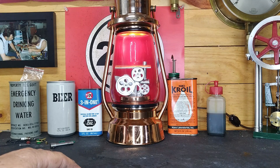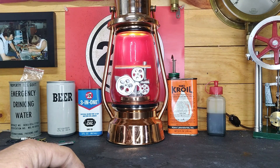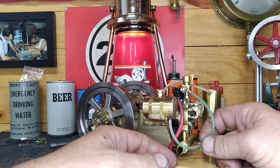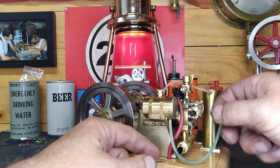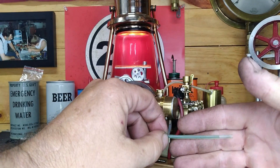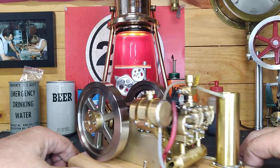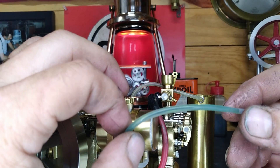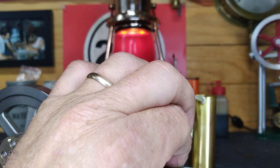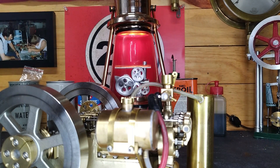Got some other projects that I want to do to it, but it's been so stinking hot out here, and I can't make a video with the fan or anything running because you guys would hear it and it kind of defeats the purpose. All right, let me get that engine up here. You can tell it's been a while since we ran it because this is what happens when that oil and fuel separates. You can't even see it but that green tint in there — that's the oil. If we try to start it right now it'll suck that oil up and we'll have a hell of a time getting it to burn out. That green tint is the oil — I'll pinch that, work it out, get that wiped off.